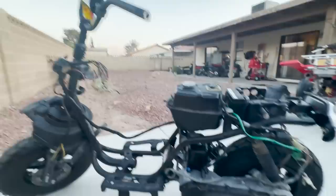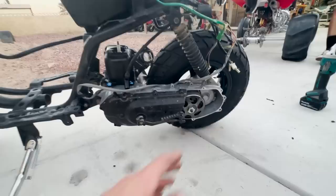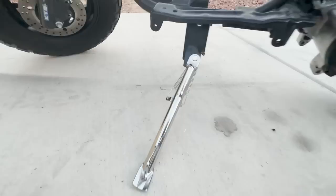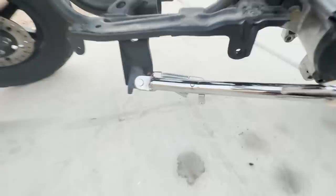Many things going down on Joe's Needs Zuma build today. We cut the kicker case — you have to cut it to fit the clutch bell. You can cut up here and leave a window or down below, but I prefer to vent out the case and let air out. People say it makes it weaker, but if you cut behind the bolt where it's reinforced, you're pretty much good. Also running the Polini Torsen arm on the other side, which makes up for the strength. We got the wire harness ran, and I just welded in his kickstand — this one's a little longer so it sits more up front.